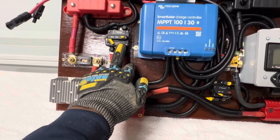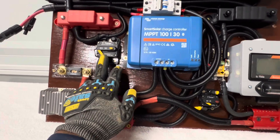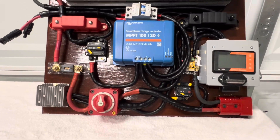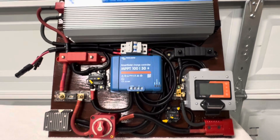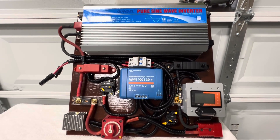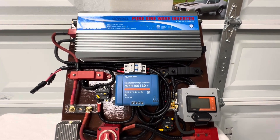This here is the same type of switch, but what this controls is the solar charger. You always want to have this on before you connect your solar panels to it. If you don't, you'll burn this up. Hope you enjoyed the video. Please subscribe. Please give me the thumbs up. Next time you see this system, it's going to be running. I'm going to put some batteries to it, put some loads on it, and let you see this in operation. Hope you enjoyed the video. Thank you.